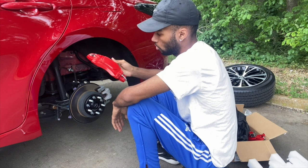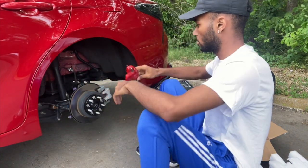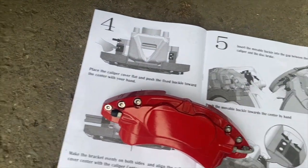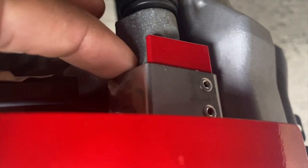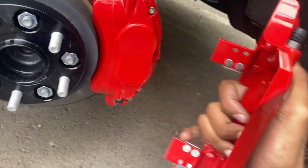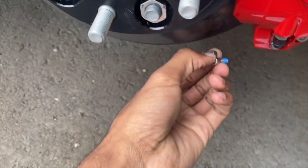This is the smaller one — the one I opened up earlier. Make sure the rubber piece right here is facing up. I'm showing you this just so you know, in case you get HRS caliper covers. The manual says the rubber piece is supposed to be on top, but when you go to the back, that's not the case. The rubber piece has to be on the bottom because this clip will not fit on the bottom the way it's supposed to otherwise. When I was trying to fit the rubber piece up top, it was not fitting whatsoever. So now you get the hardware — the little bolt and screw — and get under there and get the work done.